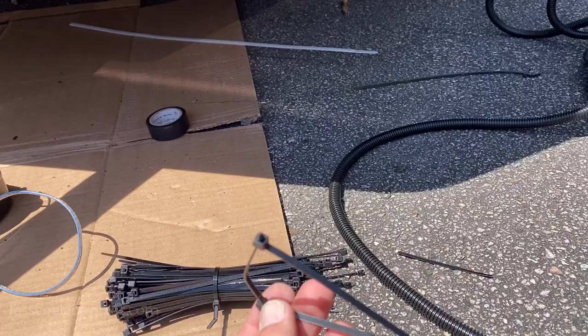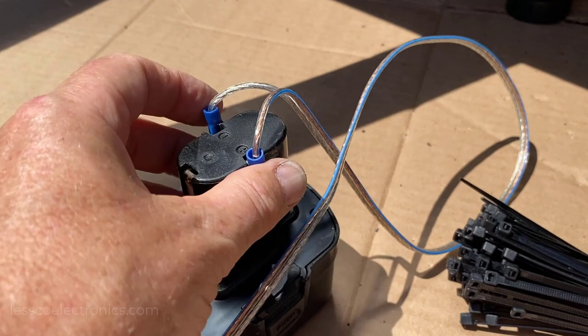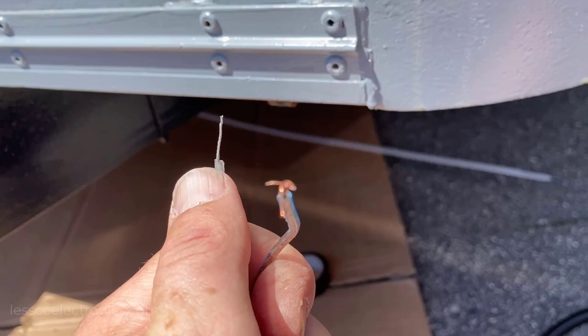Here's a tip for when you're testing your lights: just take your extra drill battery, use a couple of fork terminals, get a piece of speaker wire with varying lengths so they can't short against each other, put one against the frame for your ground, and touch the copper end to your light bulb to verify if it's actually working before you button everything up.